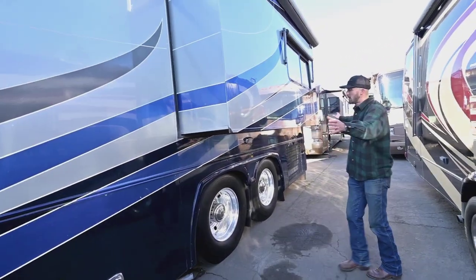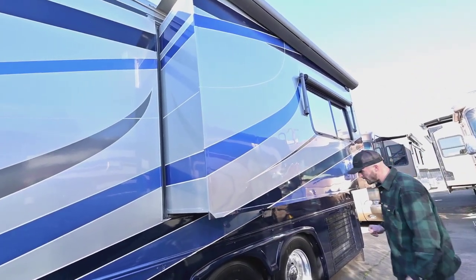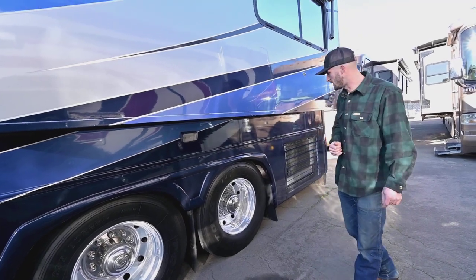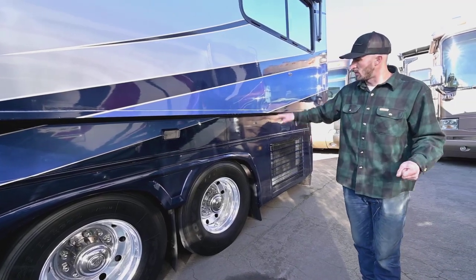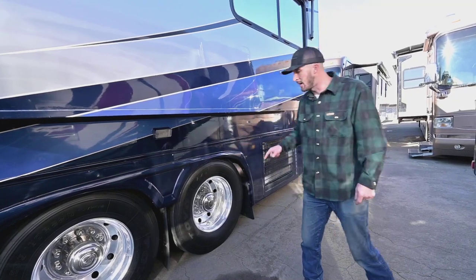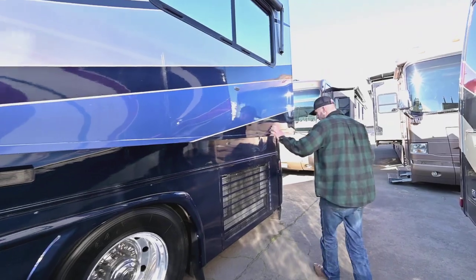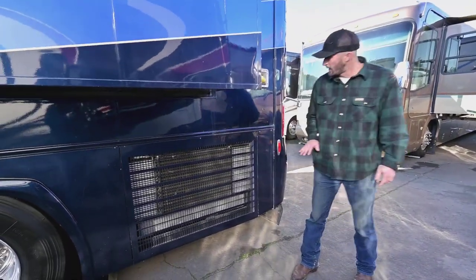Another big slide — this is the bedroom slide — with slide topper and window awning. Our tag axle: it is a tag, not tandem, so this is your drive axle. This one will lift up to articulate the rig tighter. The Dynamax chassis that Country Coach used turns so darn tight that if you don't lift that tag up, you're basically dragging rubber sideways — pivoting on your inside rear tire. Lifting it won't hurt anything if you don't, but you'll shorten tire life. Side-mounted radiator with trans cooler, intercooler, and radiator all in here.